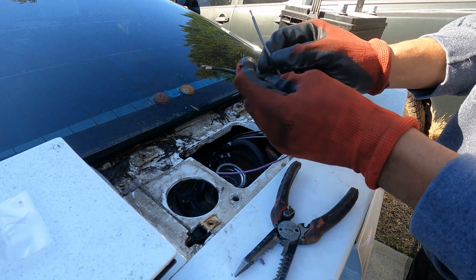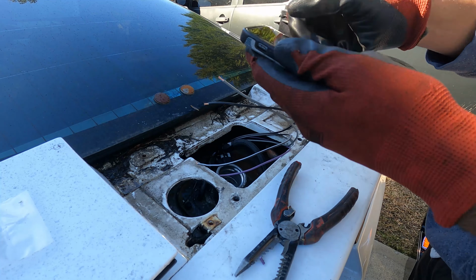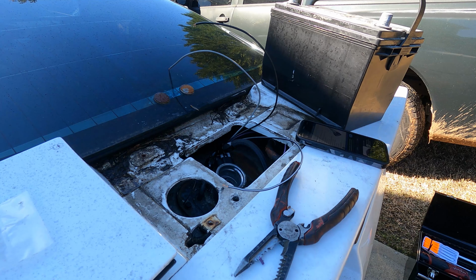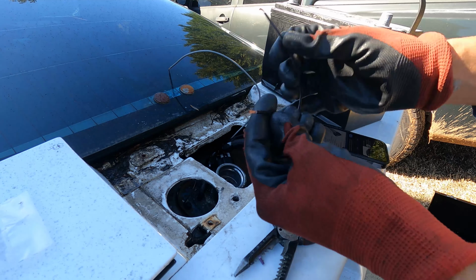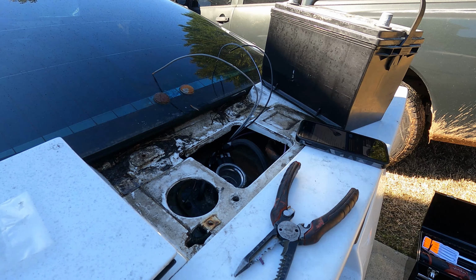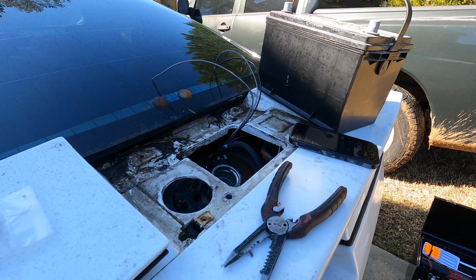So in theory, according to this diagram, assuming, actually no, I just looked and this is not correct. So we confirmed the correct wires for this are the two blacks. Now that we confirmed that, we're gonna go down to that Corvette style fuel filter and take off that main supply line just to ensure that it's getting there.